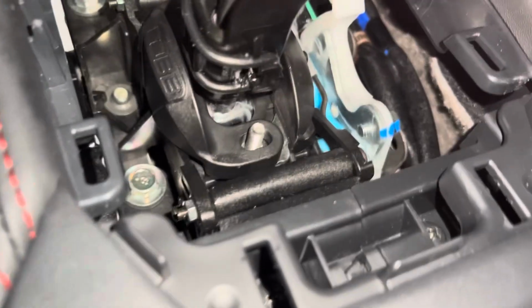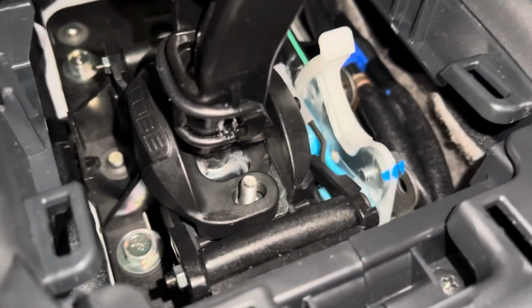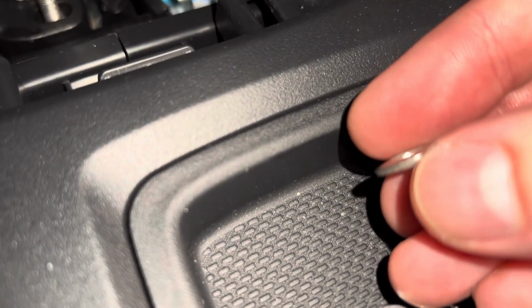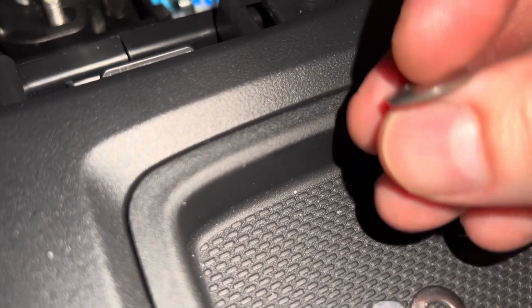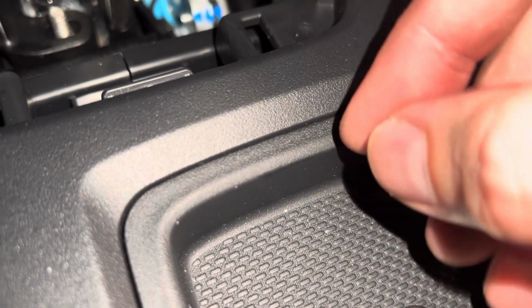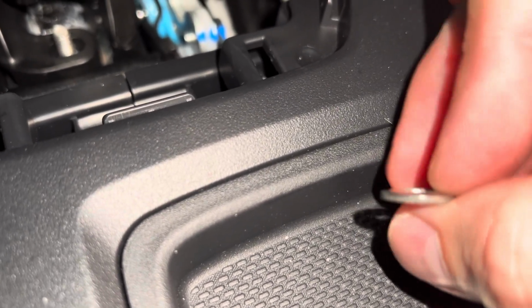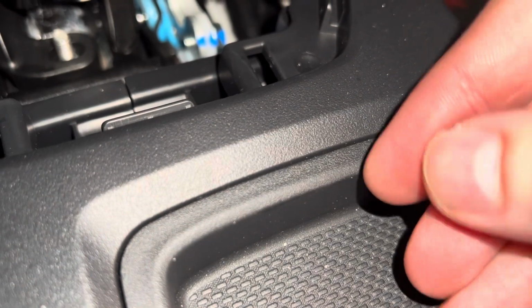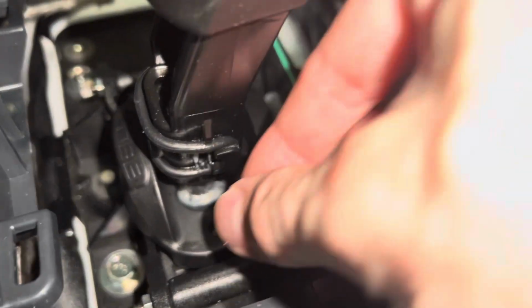All right, so we have the COBB stop placed over the COBB nuts that hold in the reverse lockout stop. Their instructions are pretty goofy for the hardware. You've got these almost conical washers that are being used as a compression or lock washer, more like compression to keep it in tension. It says the pointy side facing up, which I think is interesting. It's basically the curved, convex side facing up. Hope I'm saying that right. But you can barely tell. There's a concavity here, a dome here. So maybe another term is the dome side facing up. So we'll go ahead and drop that on.